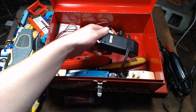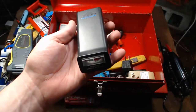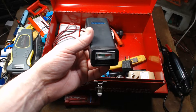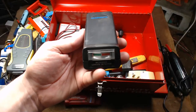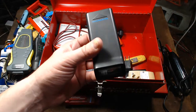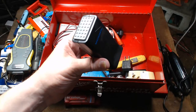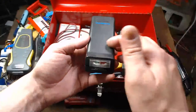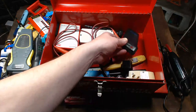I have a microwave leakage detector. Radio Shack used to sell these because a lot of old microwaves had doors that didn't shut very well, and you'd actually have quite a bit of microwave radiation leaking out around the edge. I actually have an old 1984 microwave that weighs 85 pounds — a Quasar convection oven — and I've used this tool on it and can't even get the needle to move. These detectors are essentially a 2.45 GHz radio detector.